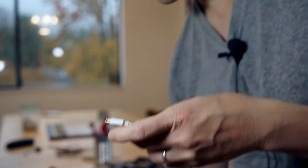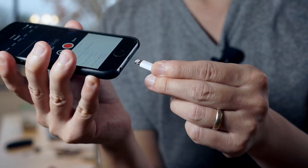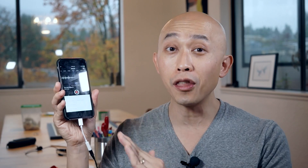One thing you have to know when connecting an external microphone is that you have to unplug the lightning cable, connect your microphone, and then connect the lightning cable back into your phone. Otherwise, it will not work. I tried it where I had the app running already and just unplugged the microphone and put in the microphone with the cable already attached — it didn't work. It reverted back to the phone's internal built-in microphone. What you have to do is unplug the lightning adapter first, plug in your microphone, and then plug it back into your phone, and you'll be good to go.